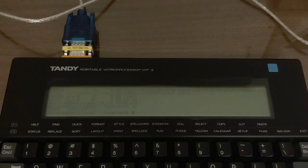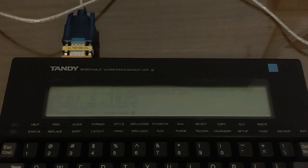I'll have to try this out later on with Telnet or TCP Serial, which would pass a Telnet connection over USB serial like MCOM does for, say, logging into the Level 29 BBS. But anyway, that works okay, but the refresh rate's kind of slow, and maybe I'll try this at 2400 baud. It seems not to be keeping up at 9600. Next, I'll give a quick peek at something really cool we can do with this.